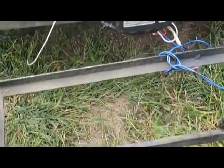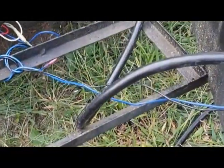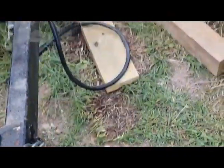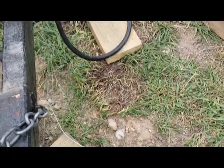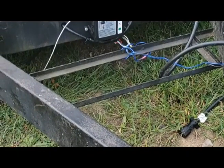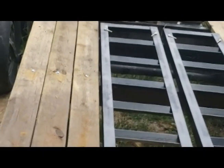With a little bit of wire loom it actually looks a lot nicer. That one white wire, I've got a ground set. I'm also going to get some wire ties and wire tie everything all the way to the end. I need a clip for the breakaway cable — probably just a little metal latch hook. The next test is to connect it to my van and see if all the lights work. My connections are made. My standing lights work fine. My directionals work fine. But for some reason my brakes don't work — so I've got to figure that out.